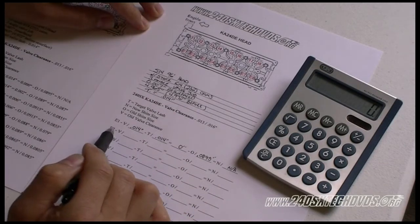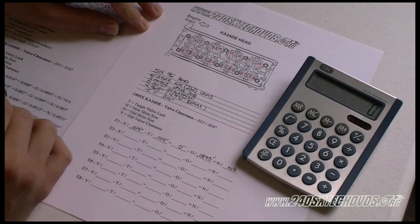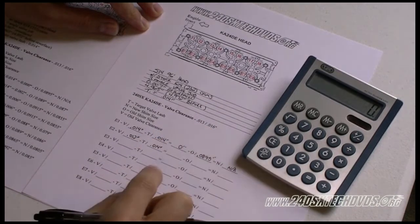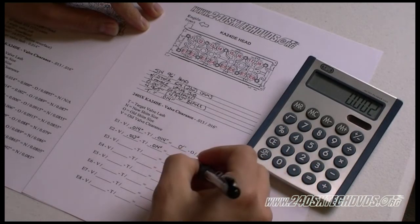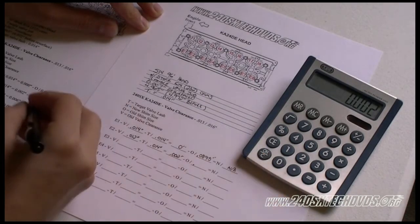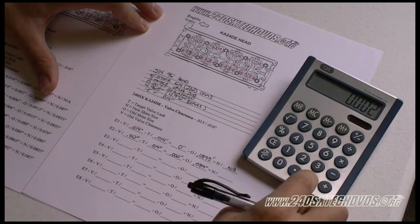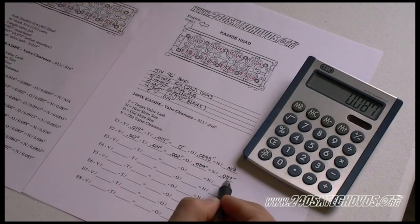So I'm going to do number two with you to show you how it works. First off, I need to get V, which is my old valve clearance. I go over in my old sheet, where I wrote it down, and it is 0.012 inch. My target is 0.014 inch. So I'm going to minus the two: 0.014 minus 0.012 equals 2/1000 of an inch. And then I need to write down my old shim size, which over here I have, 0.089 inch. So I need to take 0.089 minus 0.002 equals 0.087 inch. So that is my new shim size I need there.